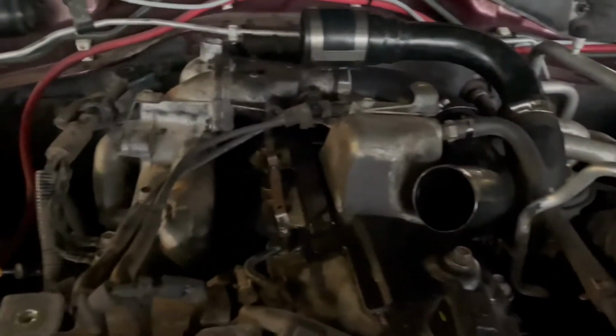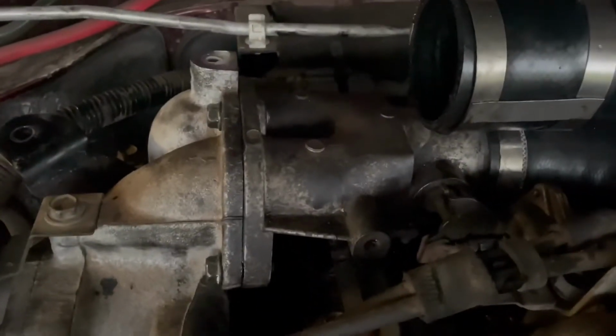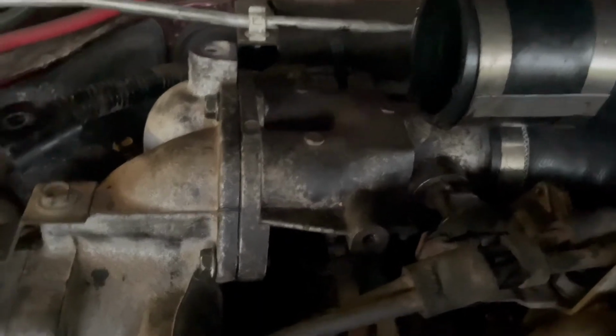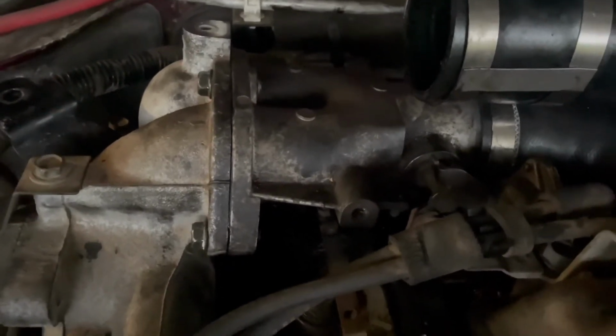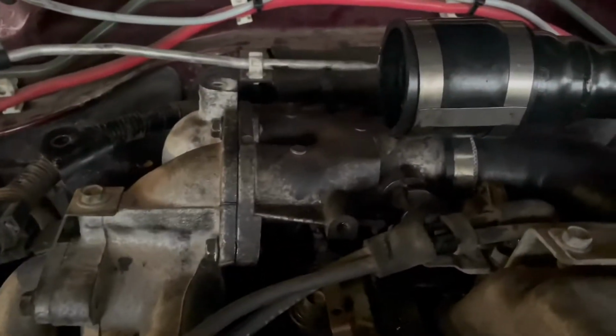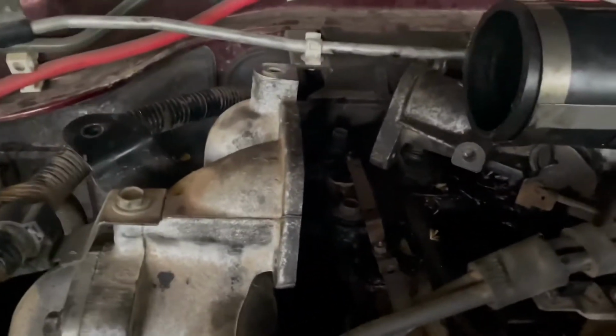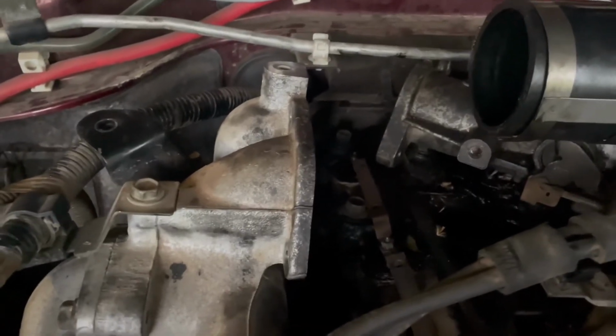Okay, then we start to see the rail from the glow plugs. There's just one more thing here, which is the intake manifold, I guess. That's still in our way, so we'll also have to push that one back a bit. Yeah, that's the part where you have the recirculation of your exhaust gases back into the engine. So, as you can see, I loosened this intake manifold.